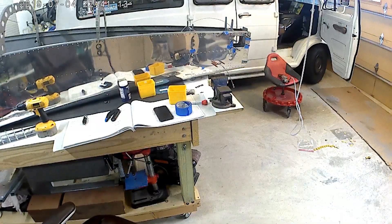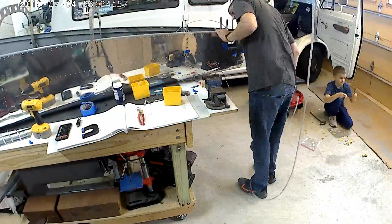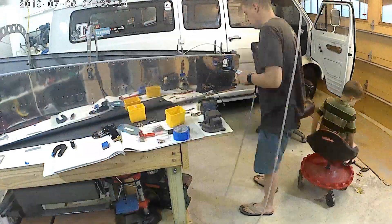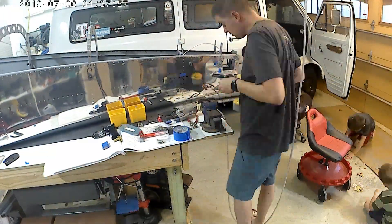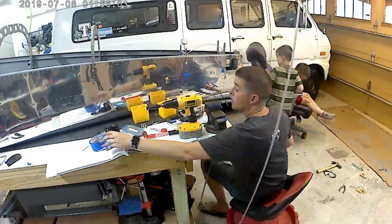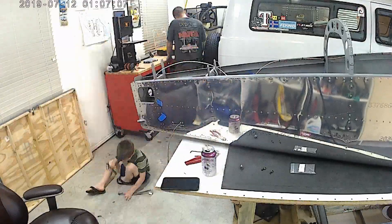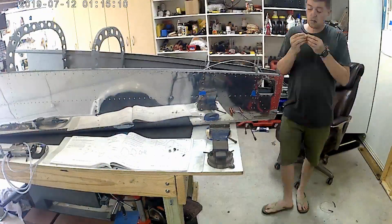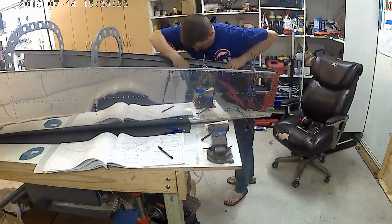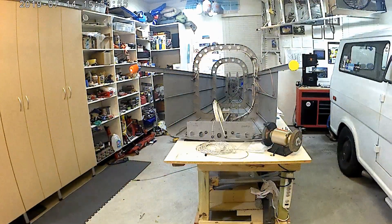I know everybody has seen dimpling and scuffing, but for whatever reason I decided to leave most of that in for the top skins. For the inspection holes, I found it was just easier to go to the end of Section 10 and go ahead and dimple them. I'm doing the optional install, which uses countersunk screws for a much more flush install. I think it's worth it even though I had to go to Aircraft Spruce and buy some countersunk screws.